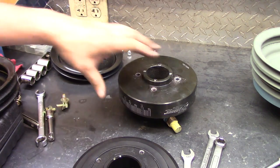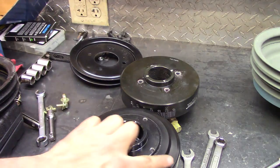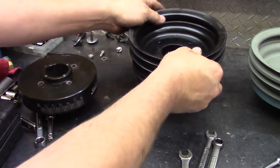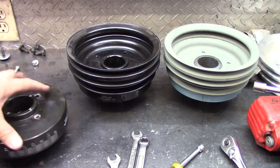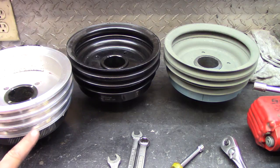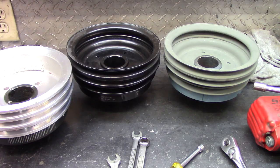I'm going to recap for anybody new to this. Here's that fluid damper - this pulley didn't fully seat because it didn't have a shoulder like this. Our new balancer matches the stock type balancer perfectly. We tried a March pulley on this but it didn't work - the grooves didn't line up. So I had a machine shop make this, and I asked him to do an undersized AC pulley. He got it as close as he could without blowing through, but if it had been a quarter to half inch larger in diameter he probably could have got the full groove depth in it and it probably would have worked fine.